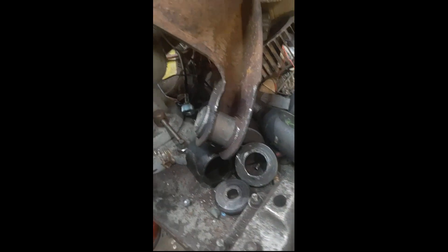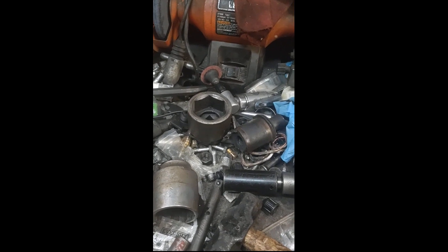It would help if I worked cleaner - I'd probably find things. I think I dropped the air chuck near the tire machine. I'm going to go to the other control arm to see if I can finish it today, then all I have to do is install it and do the ball joint press. The other control arm - I got the new bushing in and with the same setup it went in easy. The other side, the big side, came right out - so I guess you just have some trouble with some control arms and not others.